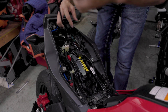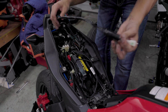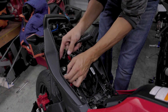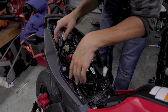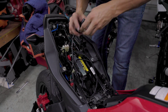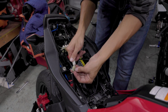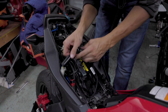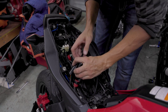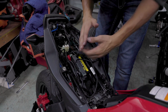Now that we've got all of our wires through here, we can go ahead and plug all this stuff back in. We're using all factory connectors, which is awesome — we don't have to splice any wires or anything like that. This loom right here just fishes back down through here, and there's a little metal holder thing where you run everything under nice and clean — almost like a built-in little zip tie, but it's a little metal thing that wraps around the wire to keep everything nice and tight. Then you just grab this and plug it into here — factory connector, real simple. Make sure you get your little rubber boot down here to cover everything up. These rubber boots that Honda puts on everything are kind of a pain, but they do a good job of keeping dirt, debris, and moisture out of your connections.